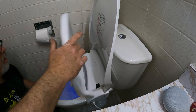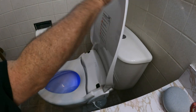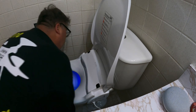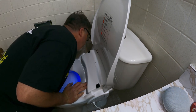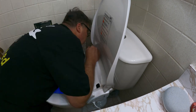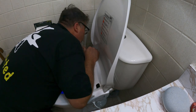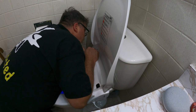There we go — it's the toilet seat powering up! That's freaking awesome. Now let's see if the remote works. We want flow, dryer — wait, I hear water running. We've got a leak! We're going to shut the water off. There's a pretty good flow going here. Looks like the O-ring was missing — no ring at all. Oh my god.